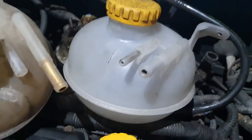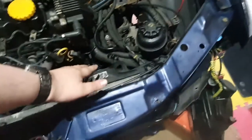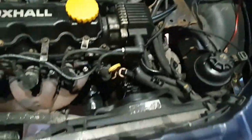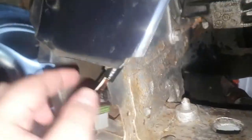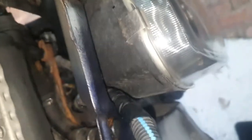Old and the new - much better. I've had to take the headlight in so I can get to - I don't know how much you can see here - but that right there above my finger, that little clip lets this come off. That pipe should come off, and then hopefully in theory this radiator should just come off once I've taken those two screws out. I've disconnected this cable from the radiator. The radiator is somewhat free - it's come out of the holder. I've drained it, so I did manage to do it. Little headlight back in for now.